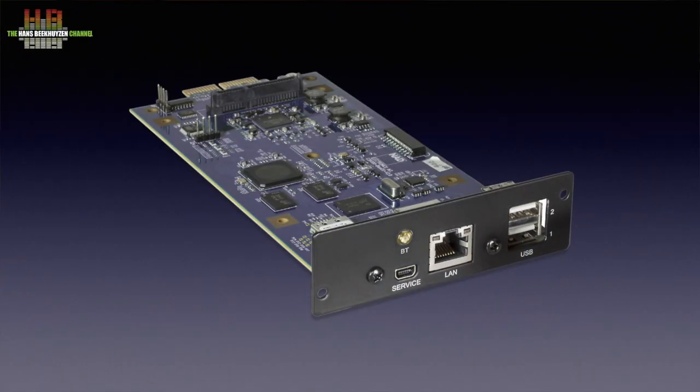As said, the C368 was fitted with the optional BluOS stream module that also does MQA decoding and can function as a Roon endpoint. It also adds APTX Bluetooth decoder to it. A Bluetooth antenna comes with the board. Wi-Fi can be added using the included dongle. The board is priced at €499 and simply slides into one of the two slots on the rear. When fitted, you can set it up using the controls and menu using the display on the front.